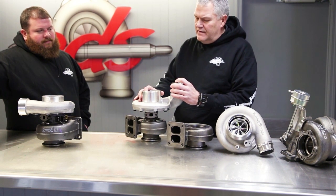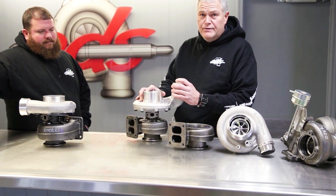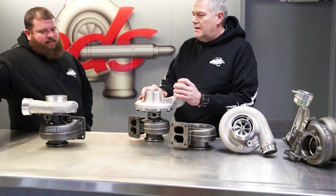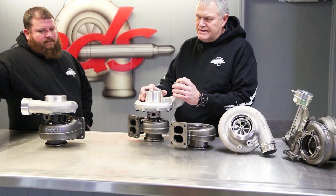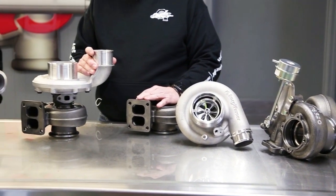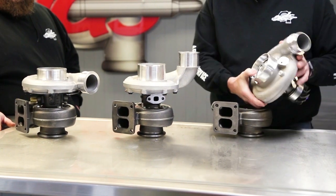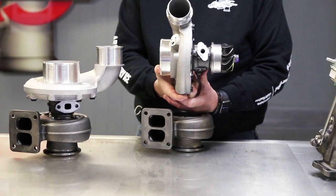Most of the time you'll find it's got an 80 millimeter turbine wheel with this 66 millimeter inducer compressor wheel, although some applications may not work perfectly for their engine. As you can see with all of these being S366s, there's a wide variety of products just in the style of discharge — this one's a straight, this is 90 degrees, this one can go a couple different ways, smaller hose size — and also this one doesn't have a turbine housing on it. This is called a super core.